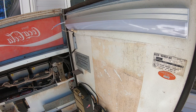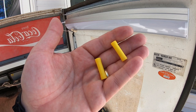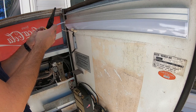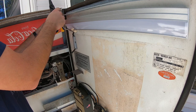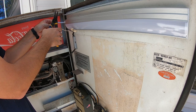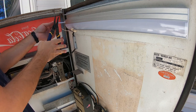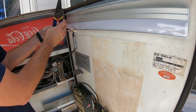I'm searching around my toolbox for the connectors — there they are. We're going to crimp those onto the wires using my crimping tool, starting with one side then crimping to the other side. Remember, this is 120-volt AC electricity — it's not low voltage, it's standard like what you'd plug into your wall. That's why you want to make sure your machine is unplugged when doing this work, because you could shock yourself.